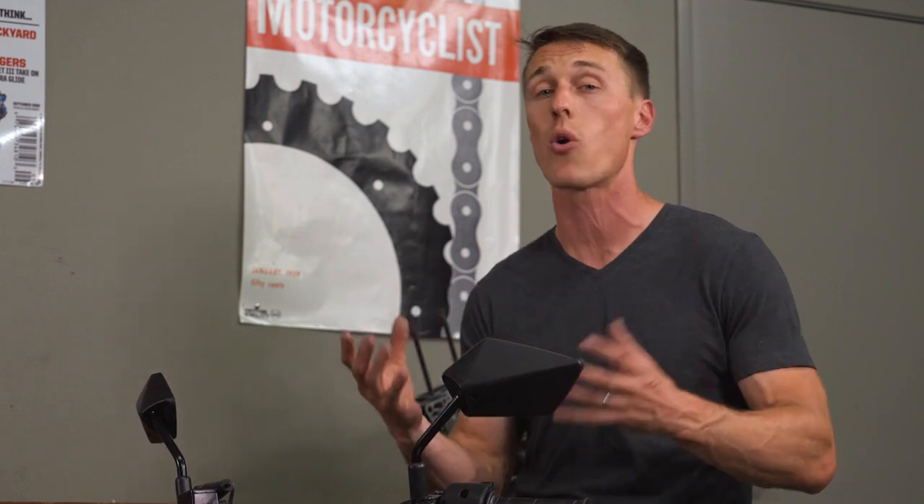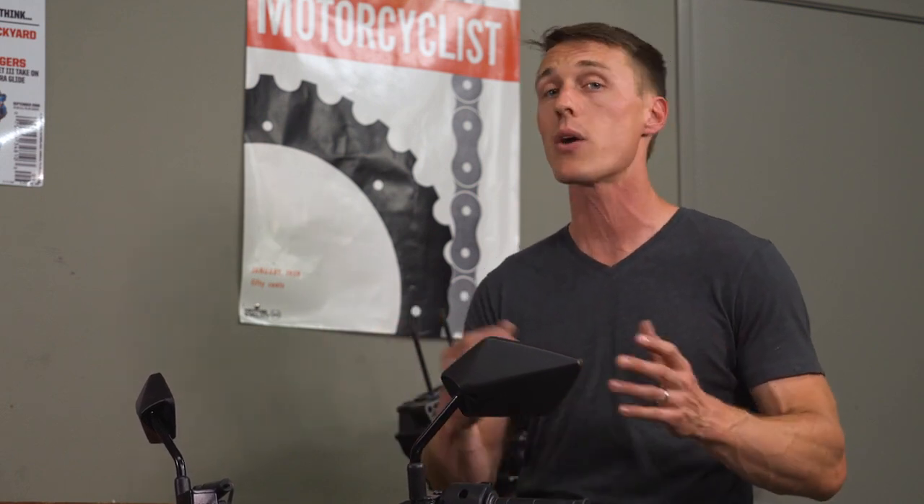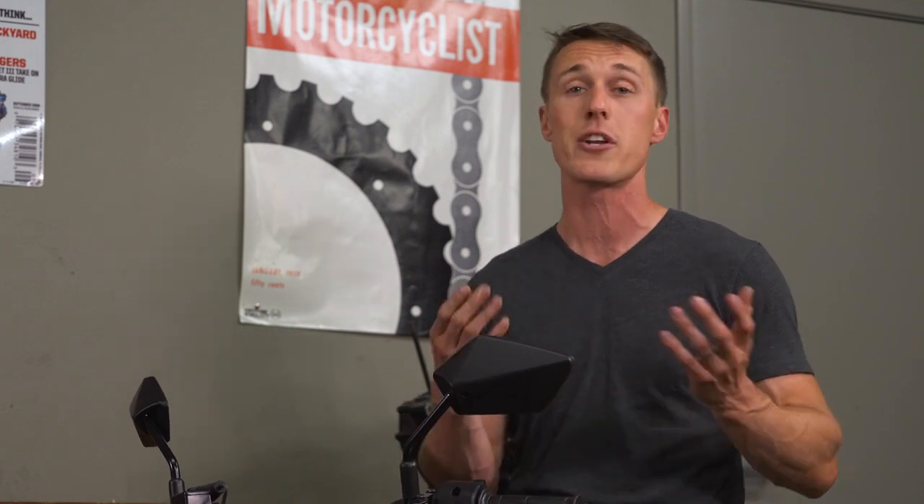If however you're still having issues with your bike jumping into false neutral or jumping out of gear, you might want to check your shift linkage. You might also have damaged gear dogs, a bent shift fork, or perhaps the shift star has come loose from the shift drum.